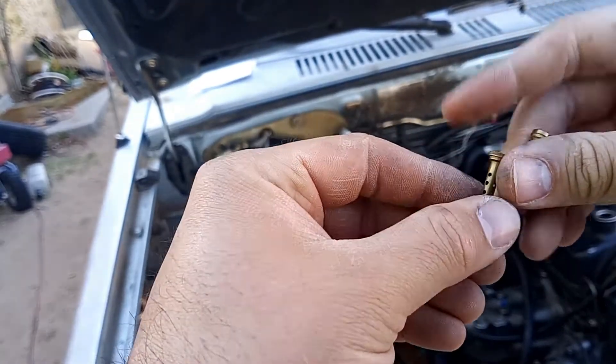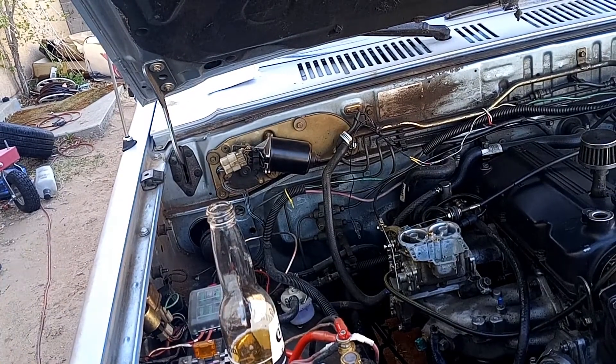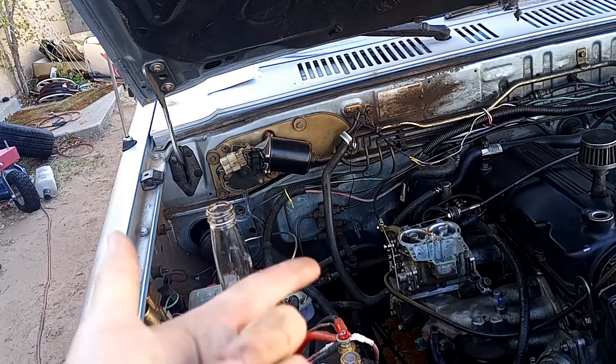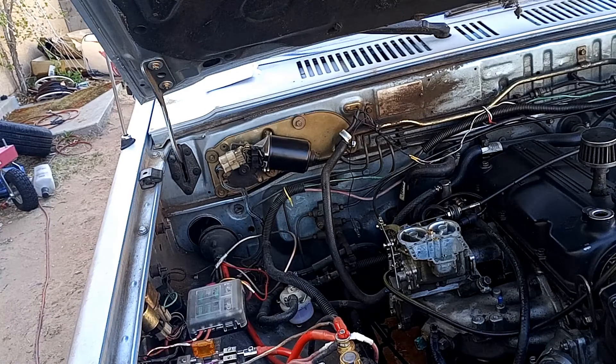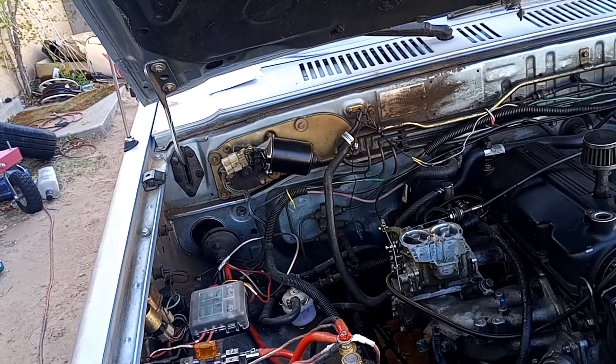I've established the baseline tune on my carburetor and it's been driving okay, but reading more into it I found out that a big part of why — when they put this carburetor together for this truck — they make it for torque and for the low end of the RPM scale. So I've been looking into the emulsion tube.